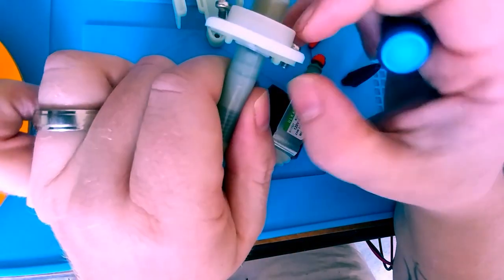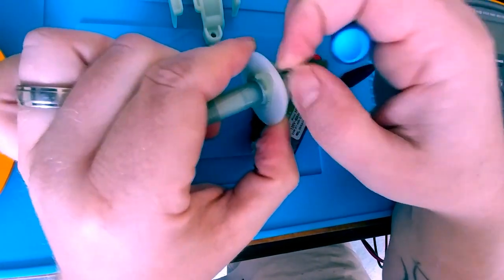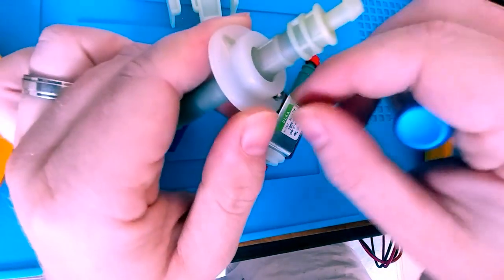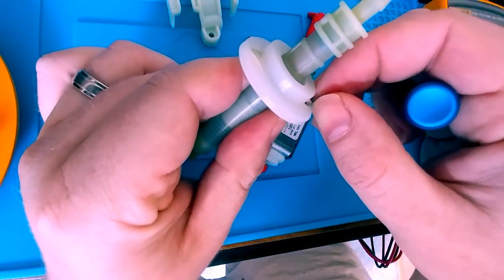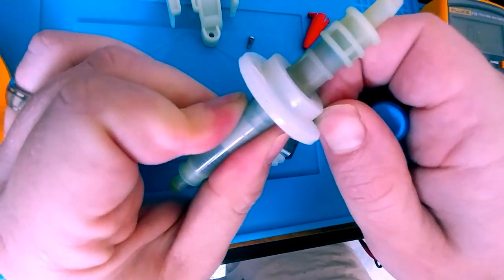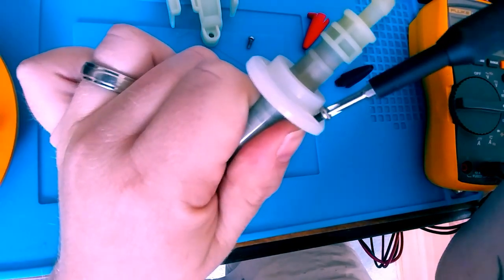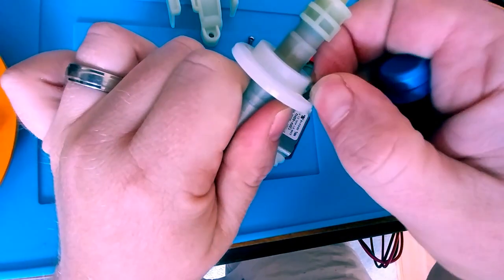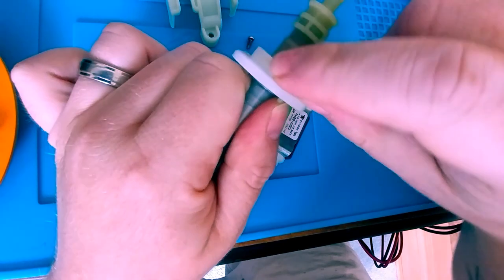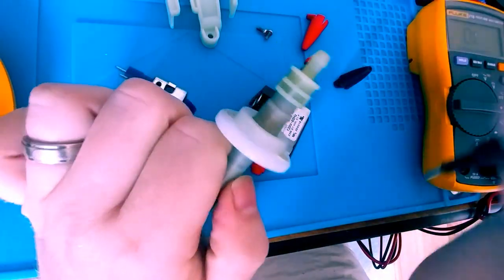just to see if it was there. There was a lot of, not corrosion, but calcium buildup inside the plunger and the spring here, keeping this thing from opening and shutting. I cleaned it up a little bit, and it worked for a second, then stopped working again. And now that I've got a replacement in, we could kind of take some comparative measurements.